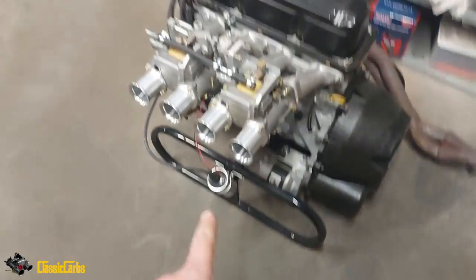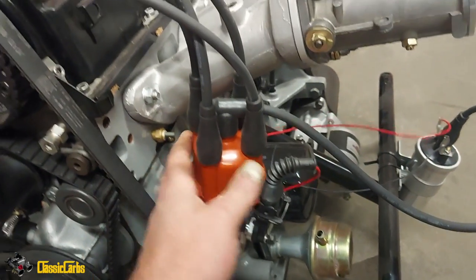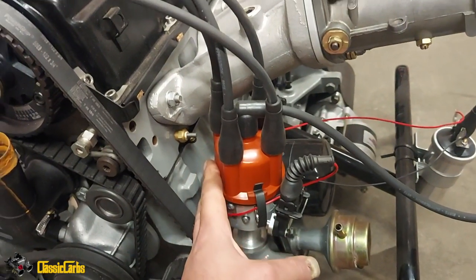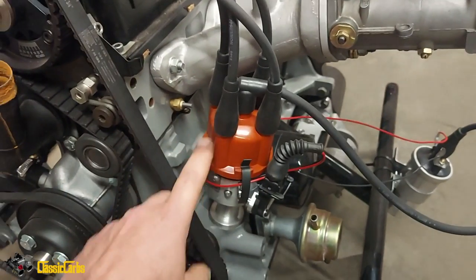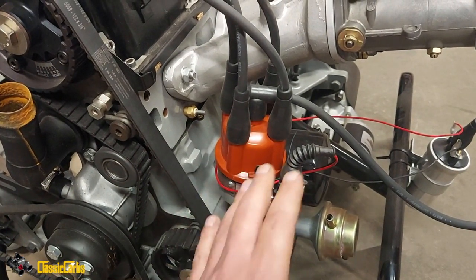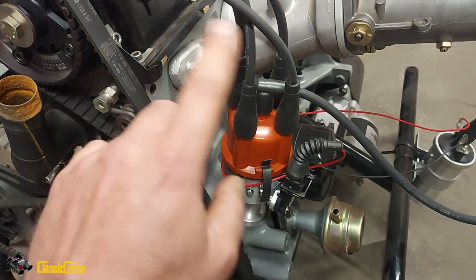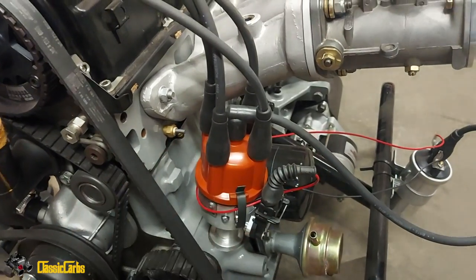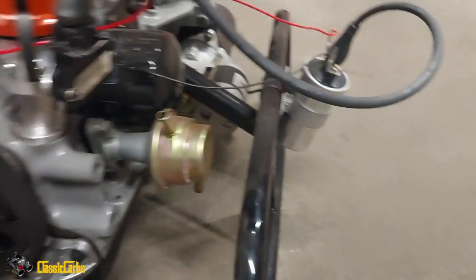And oh yeah, we've also got an H&H ignition distributor, and these guys are recommended for building nice mechanical advance distributors because these carburettors don't give you provision for vacuum advance, so you have to either do away with your vacuum advance, or go for one of these mechanical distributors by H&H here in Brierley Hill, West Midlands. And they also supplied us the coil.